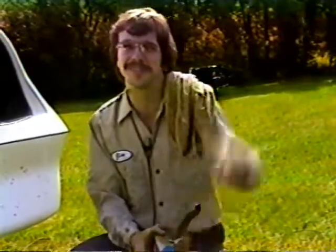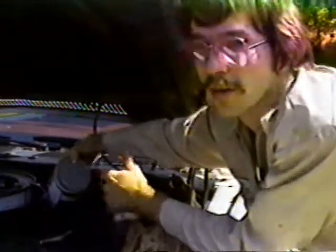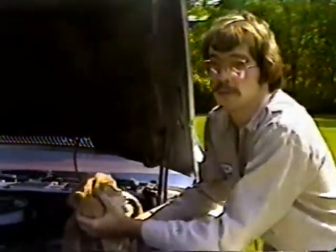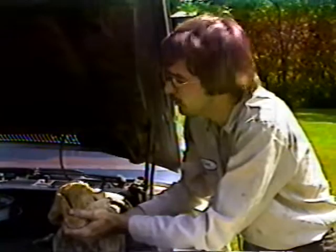That happened to me because whoever had the car before me didn't run enough oil — or ran too much — and it messed up my engine. If you hadn't changed the filter, you wouldn't need to put five quarts in, but you're pretty much defeating your purpose if you don't change the filter — it has a quart of oil in it along with little bits of metal and bad stuff you're trying to get out of your engine. You should always change the filter and the oil together; one's not much good without the other.